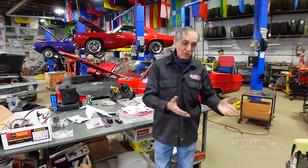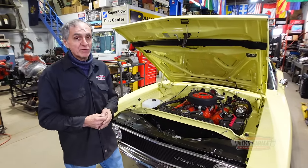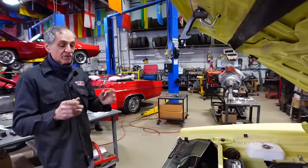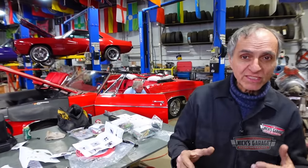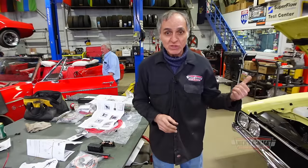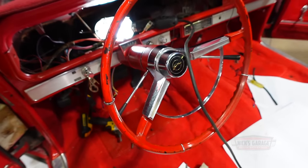Then there's another classic, for example, like the Charger 500. This is a restoration of what you call a matching numbers car. You want to go into more detail, and this is where you buy the wiring that is made exactly the way Chrysler made it. So this is what we bought for this car. We bought the exact same wiring, copies of the Chrysler way it was designed, and we put it in. And it works, it's also simple, except the harness on the dash on this car was pretty clean, so we kept the same harness. If you take this one here, for example, so many people tampered with it, extended wires, and did so many things that damaged it. And this car was a little bit different. Nobody molested this car. This one here, a lot of people molested. So that's the reason why we're changing everything on this car. And this one here was more simple. We bought a rear taillight harness, engine harness, headlight harness, left the original dash harness in the car, and it's gonna all work perfect. It's the right part for the job for every car.